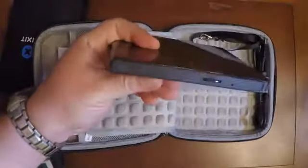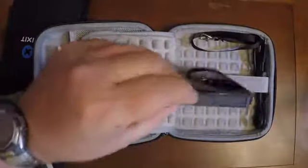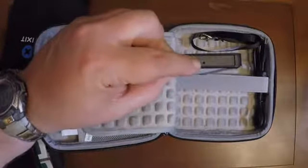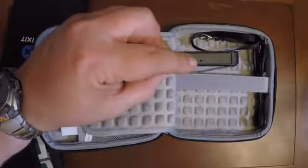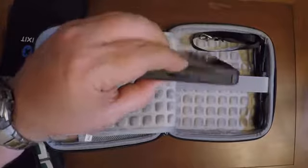And if you happen to leave a CD or DVD in here, make sure that you remember that little hole and have a paper clip nearby, because that little hole and a paper clip will get the drive to open up so that you don't have to plug it back in and get power so you can always get that media back out.